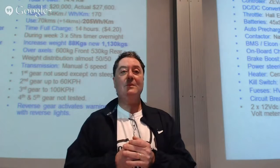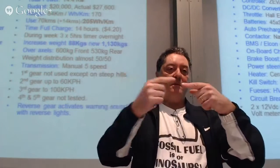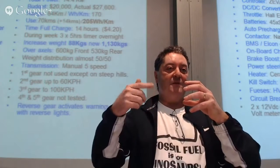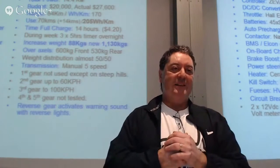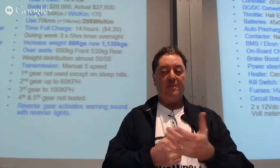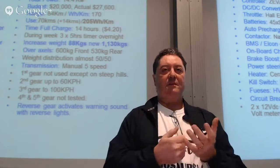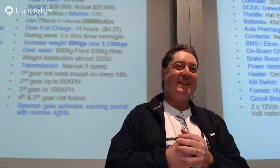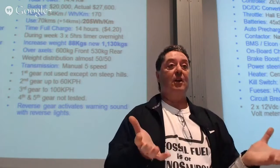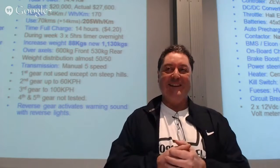Why get a gearbox to work on an electric car? Is that because you use DC? No, it's just that the drive shaft goes directly into the gearbox. So when your electric motor is turning, it's turning the shaft, and when you put it in gear, you're in gear. Usually the drive shaft goes straight to the wheels. You can, yeah. But this motor's maximum RPM is 5,000. It's rated at 5,200 RPM. Not that you would ever get to 5,200 RPM, but using the gearbox made it obviously a lot simpler, because otherwise, how are you going to drive the vehicle? Yeah, especially on a front wheel drive.